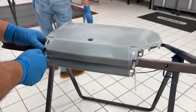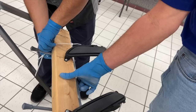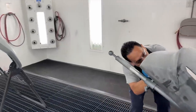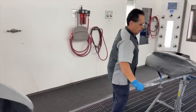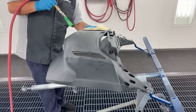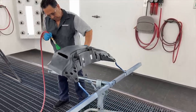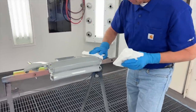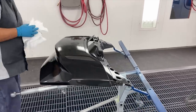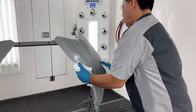To make them easier to paint, I had attached the trunk inserts to a 2x4 using screws to keep them stable. The parts are all then taken into the paint booth where they will be sprayed. This is a pretty cool rack because it allows Juan to lower and raise the part, since he'll spray a little paint on the underside of the trunk lid too. Juan goes over each piece with a tack cloth and compressed air to blow off any remaining particulate. The paint booth floor has suction, drawing everything down and out of the booth. Then another solvent is used to thoroughly clean all the parts one more time before the paint process begins.